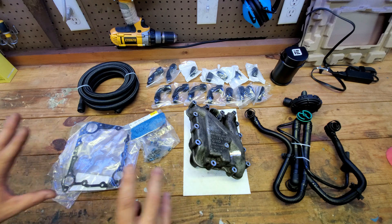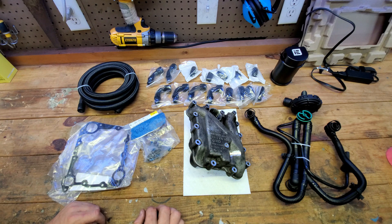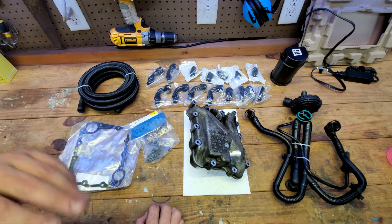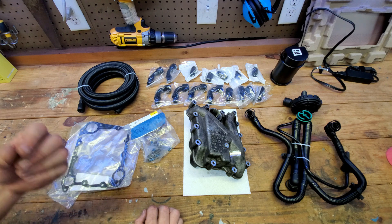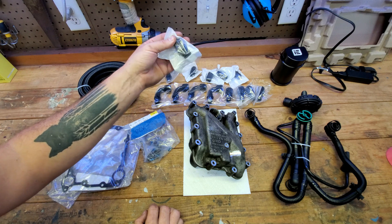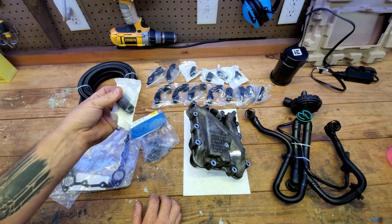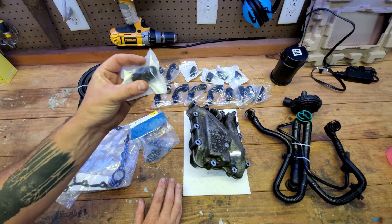If you're going to do this in a fashion where you modify your supercharger without the pieces from Merc Racing, you're gonna have to have someone weld the OEM PCV return port on the bottom of the supercharger shut — and that can be tricky since it's all aluminum. Then you're gonna have to have someone tap in a 10AN fitting into the back of the supercharger past the throttle body. I highly suggest waiting for the Merc Racing parts to make this a fully reversible DIY system.